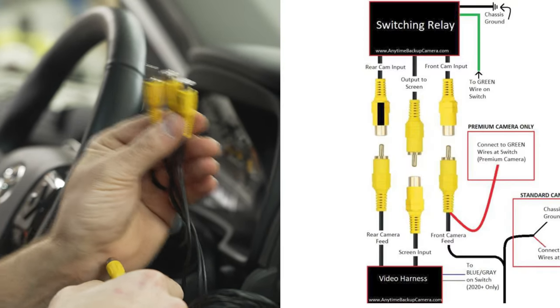We've got all of the RCAs in the back of the unit done and routed all the wires. Now we connect to the switch wiring harness. The new ground wire attaches to the side of the radio bracket. We're attaching all our ground wires to that point: the ground wire from the radio bracket, the black ground from the video relay, the ground wire from the camera outside — I did have to use a little extension on this — and the ground wire from the switch wiring harness. I secured all the ground wires together with a closed-end crimp connector, electrical tape, and a zip tie.